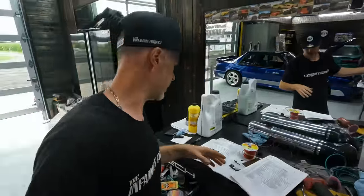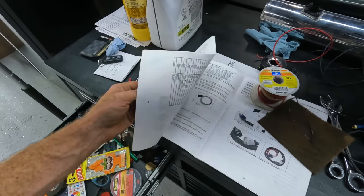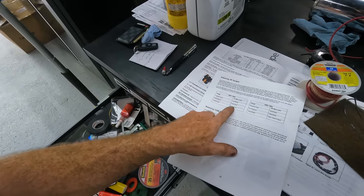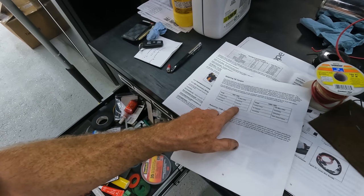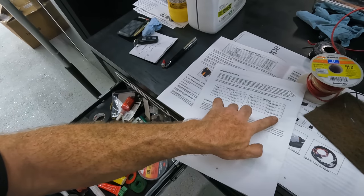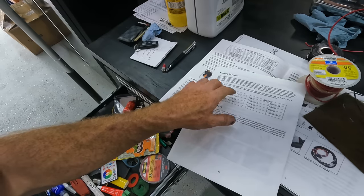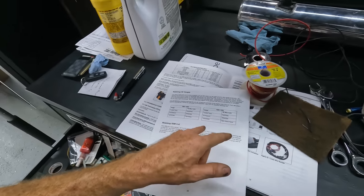And this car's scenario for me, Holley has actually got it wrong here. If you have this manual, they're saying if you want to retain your factory style gauges, so your coolant temp and oil pressure and tach, which in fact I am gonna wire these up. The tach, more specifically, 87 through 89, it's saying it's tan and yellow, and 90 through 93 is saying dark green and yellow. Well, flip these two around, guys. 87 through 89 is actually dark green and yellow, and 90 through 93 is tan and yellow. Everything else is the same, red with white, white with red.